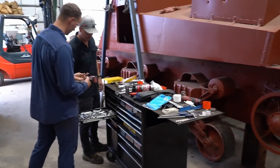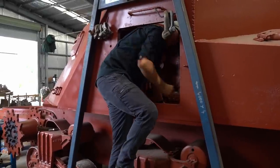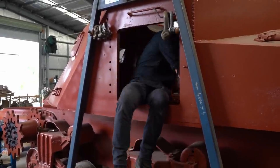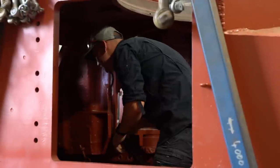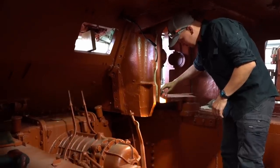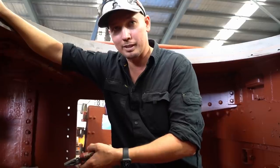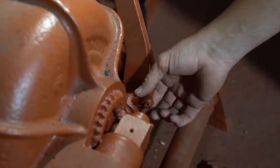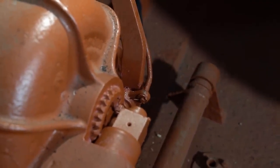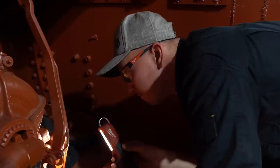So far the mechanical side of things in the Grant looks great. The final drives, differential and gearbox are all in fantastic condition. But the external parts have been exposed to the elements for decades and have been painted over - they're seized up pretty badly, but this is nothing the boys can't handle. We're going to remove the gear shift linkages, free up the reverse lockout, remove the handbrake system and free that up as well. You push that button down, which pushes this rod down, and then there's a linkage that releases so you can pull up and select the shaft into reverse - so when you're changing through the gears you can't accidentally go into reverse.